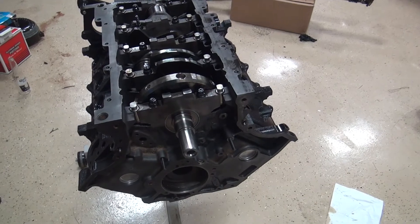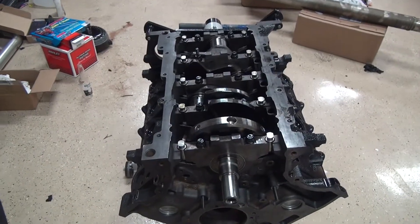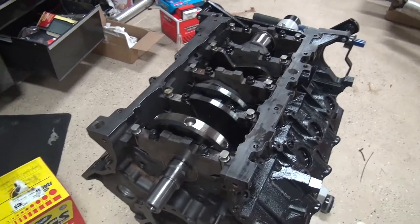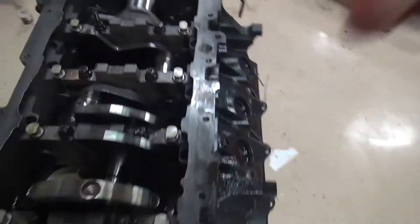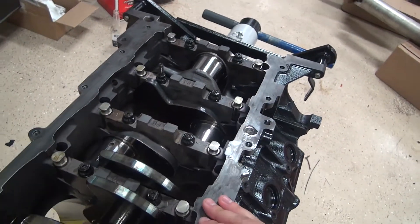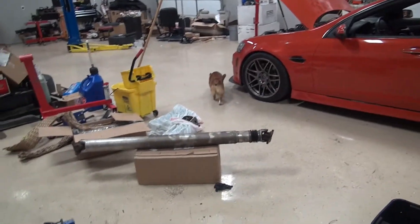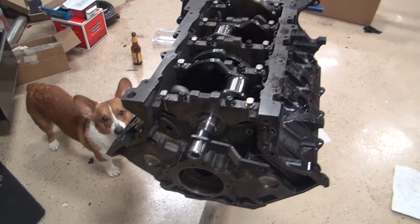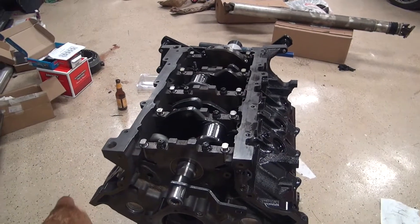So after a few beers and a little bit of frustration, I got the crank thrust pretty much spec'd out. Next is just assembling the rods and pistons, so I actually have to clear some space to do that because what I'm working with right now is a mess. I have all the mains torqued down and the side main bolts torqued down as well. Next is just assembling the pistons and rods, so I've got to take them out of the box and start assembling them.